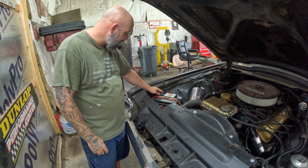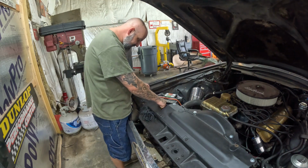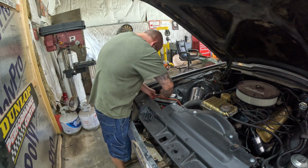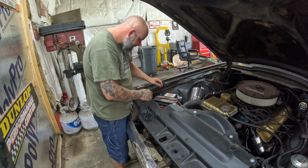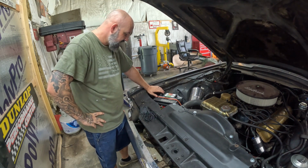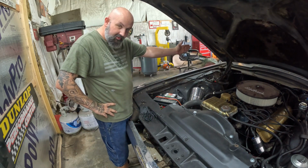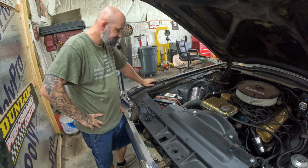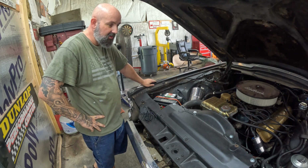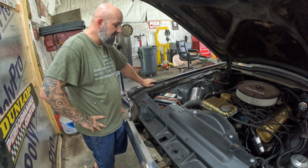It's the only thing we had, so we'll work with what we got. We'll have a power wire hooked in here to the power of the battery, and then this will run alongside it. We've got this hooked in down here to switch power off of our solenoid, and we'll fuse all this stuff too. There'll be a fuse up here or maybe back there, but either way, there'll be a fuse. We're going to drop this wire straight down, run the frame rail straight back, and take it into the hole that we had punched for the airline. We'll use that one hole for both purposes, and then that'll be it.